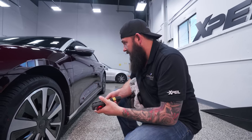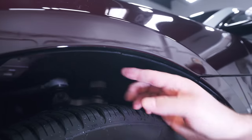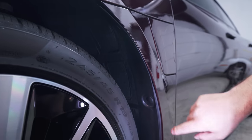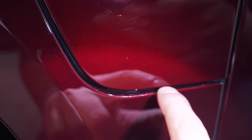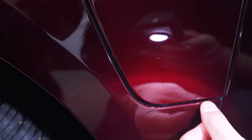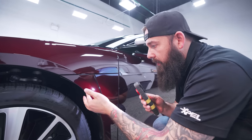Going through it inch by inch - you can see this inner wheel well here is not tucked in properly. And then I'm following this down - look at this. See the seal? The seal has paint on it. I can feel it right on top and you can probably see it on the camera. This is what happens when you tape something off and you have an edge on it - you can feel this edge. This has probably been repainted here.